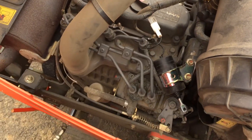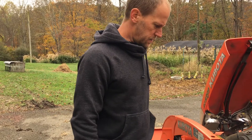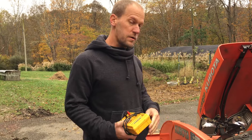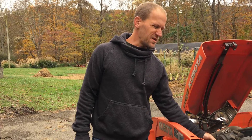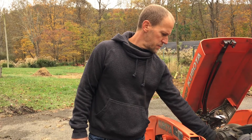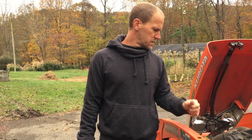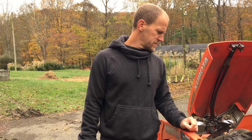Okay, let's give it a shot. So we swapped the solenoid out and it didn't fix the problem. I didn't really do much testing before — I just assumed it had to be the solenoid, that's the obvious thing, and as cheap as it was I went ahead with it. However, that's apparently not it. So I'm going to start electrically testing. It could be the switch itself making bad contact or something else. I'll start here at this plug-in and see if I get a signal change.